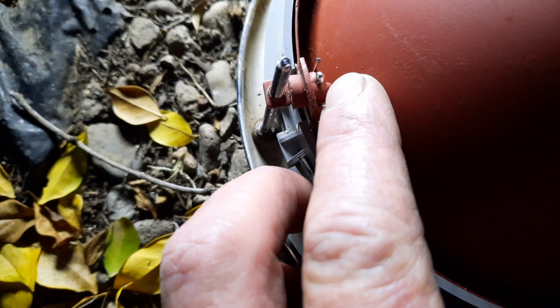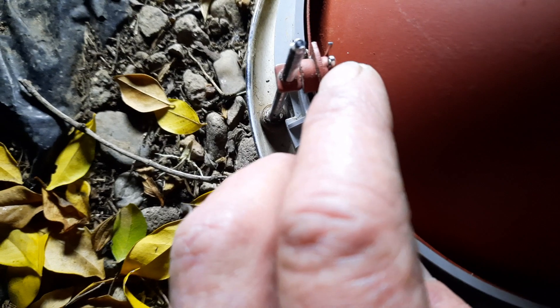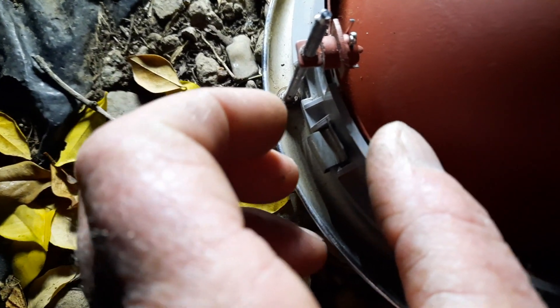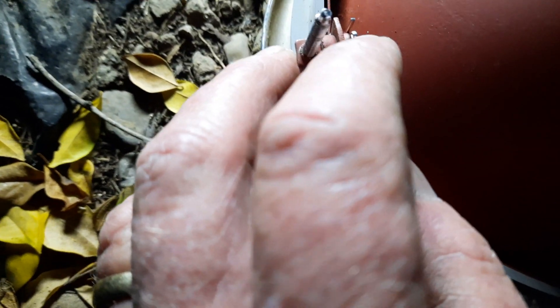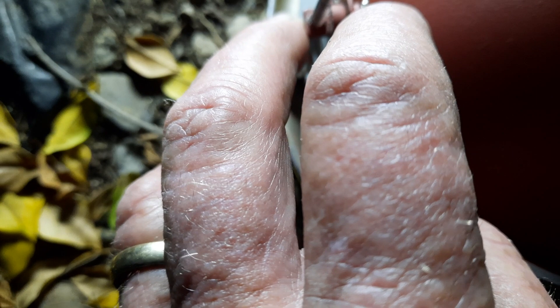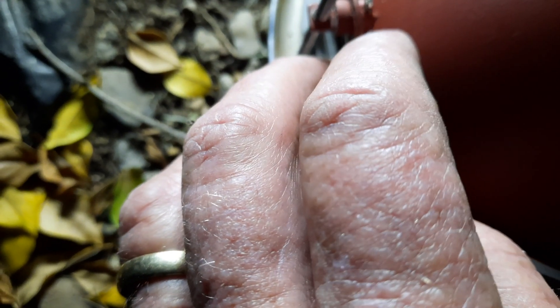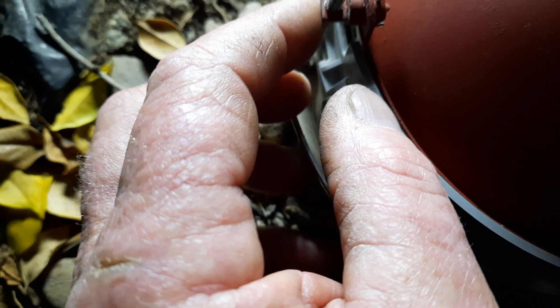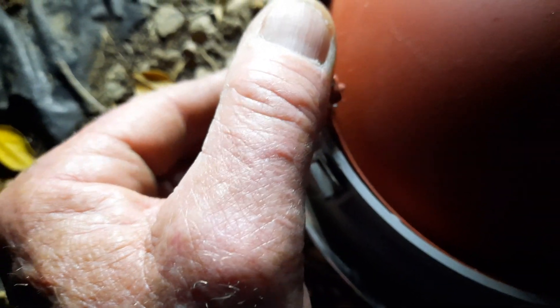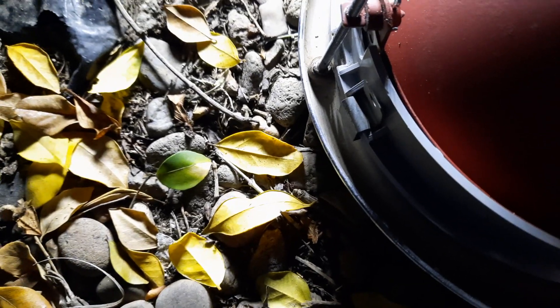On this side there wasn't enough metal tab sticking through to drill a hole on the outside, so I had to drill through the rubber. With a tiny drill under pressure it starts twisting and if you keep going you'll just snap the drill. So I started it from both sides, drilled through the rubber enough to put a mark in the middle tab, then pulled it out, put it in the vice, drilled right through, and put the split pin in through the rubber. There's no way they can pull out now — that ends this problem of the pins falling out of your headlights.